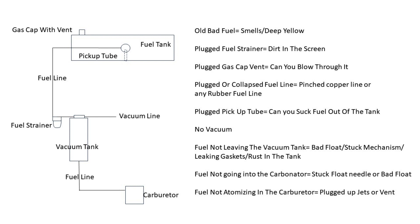The fuel gets sucked into the vacuum tank. Once it hits a certain level, it gravity-drops down through the fuel line and then goes to the carburetor. The ultimate problem I had with this vehicle was in the vacuum tank - I had multiple failures. A cork had swelled up and was binding, then the mechanism had varnished up so bad with the bad gas that it was sticking. I ended up taking the mechanism all apart and polishing it with a buffing wheel.